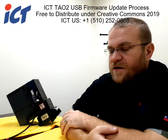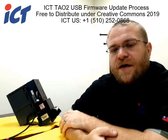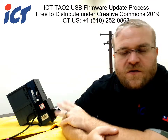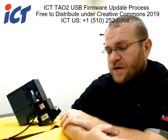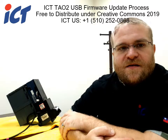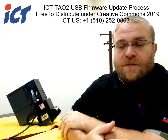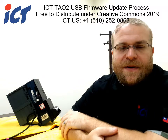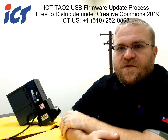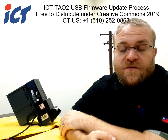That is done just by getting a USB drive — 2 or 4 gigs. The smaller the better. In our experience here, the larger drives you use, such as anything larger than 16 gigs, you might start to run into some compatibility issues where the firmware won't actually proceed or will just sit there doing nothing. So you want to be sure to use the right kind of USB drive.